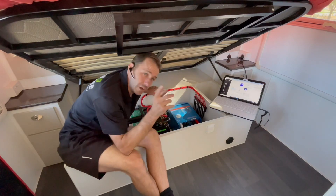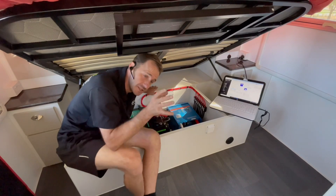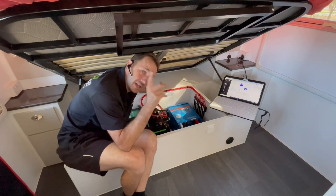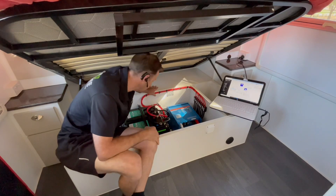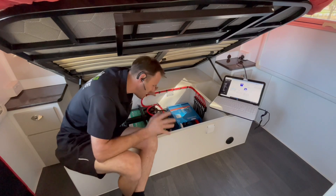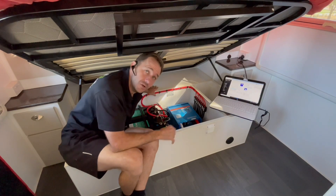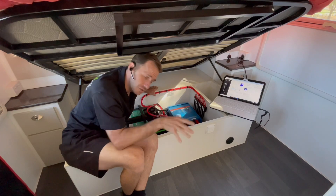We have upgraded the air conditioner for old mate on this. We've gone for the Hardi Harrier Light — this is a smaller van, only a little 18-19 footer, so we put the light version on. They are super efficient. Running the air conditioner during the day — not a problem at all. During the night it's around 30 to 60 amps, it is variable. Run it on night mode, which is what I try and tell everyone to do with these Harriers — put it on night mode, they use bugger all. Really easy to use.